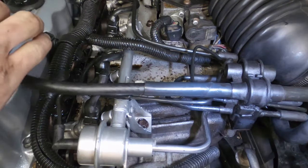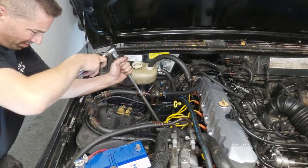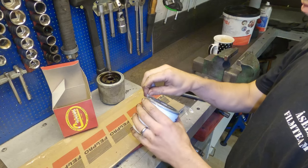The other thing is general maintenance - don't skimp on that. You want to be checking brake lines, changing brake discs, checking ball joints, having a look at the steering knuckles, tie rod ends, all that kind of stuff. Most of the time when you buy a Cherokee, it's all garbage - totally wallowed out with play in everything.